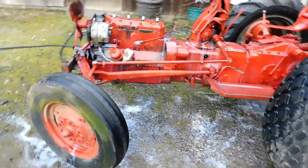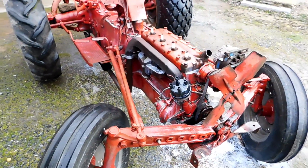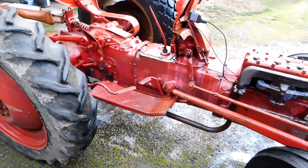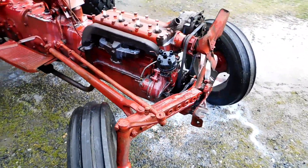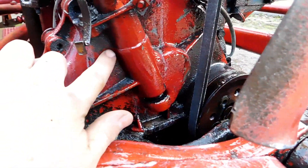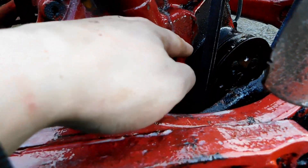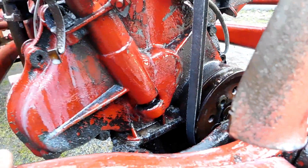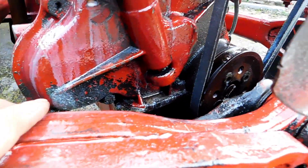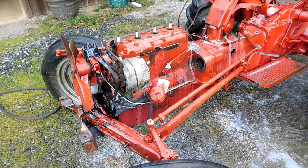The cleaning process is well underway here. I just shot it with a can of Engine Bright to help the grease and stuff lift off. I was working at it with some Dawn dish soap and having some luck with that, but that Engine Bright is pretty tough stuff. So I shot her with that and we'll try hosing her off to see how much of this grease and grime we can get to come up. I noticed I've been scrubbing in this area here — usually when you've got an engine with a lot of hours on it, especially where the crank seal is, the oil and crud just gets caked on. That's not really the case with this motor. It's greasy and oily, but it's not a real thick coating, so I'm thinking the motor hopefully doesn't have that many hours on it.